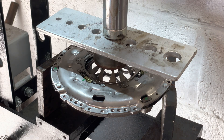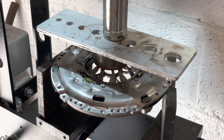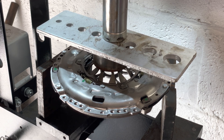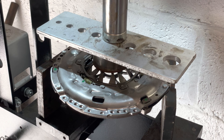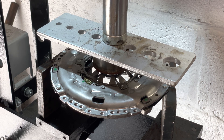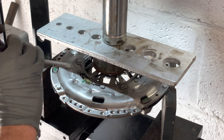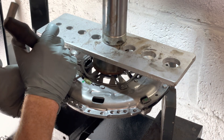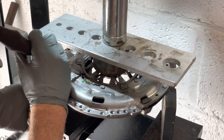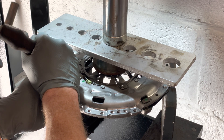You want to slowly apply pressure, and when you get to the point where it's adjustable you'll hear it start to click. You'll see it start to de-edge off — there we are, that's the first click. Give it a little bit more and you should just be able to push it back. It's sometimes a little bit hard, but you can get a bit more and there you are — push it back and then just release the pressure on the press.